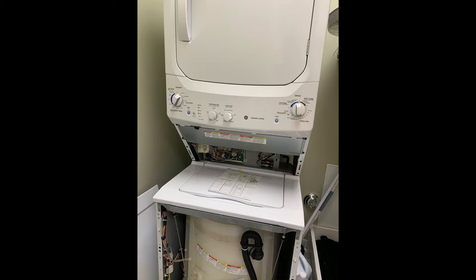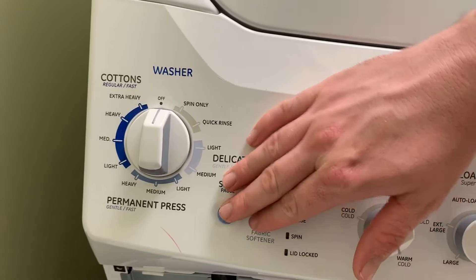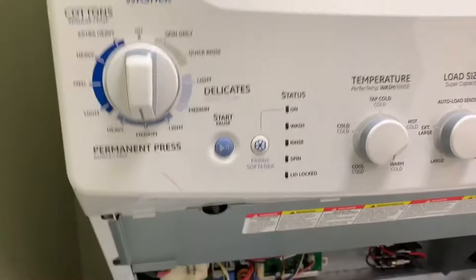Just to let you guys know what unit we're looking at — on the left hand side is the washer and on the right hand side that dial is for the dryer. Now, getting into diagnostics — two easy steps: hold the start and the fabric softener button right next to it, while doing that turn the knob down to the six o'clock position, and wait a few seconds then let go. Once you see all the lights blinking like that, you know you have made it into diagnostics.